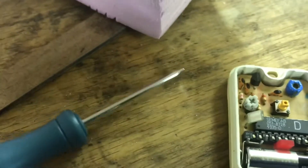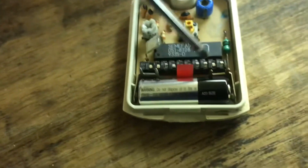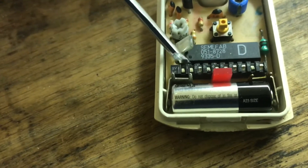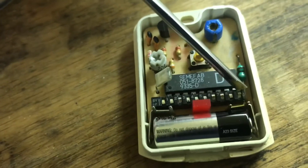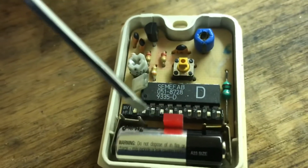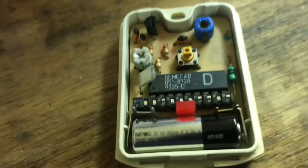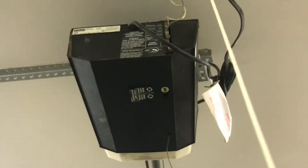It's basically easy. All you have to use is a flat-headed screwdriver and then push these little switches up and down. Up here means on and down here means off. You guys can have it in any sort of certain pattern — on off on off, or on on on, or off off off, etc. However you want it is up to you. If you want to program it, you've got to match the program that's currently on the opener up here, if you want this to work.